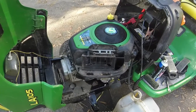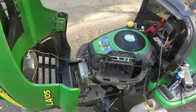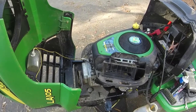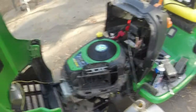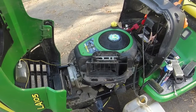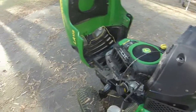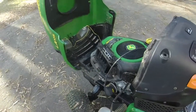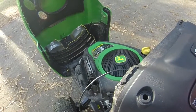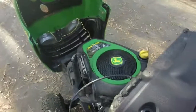I'm gonna clean the plug once again, because I think, like I said, it's fouled, and I will try one more time to get it going. If not, we'll catch this back up in part two, just so part one doesn't get so long. And yeah, so we'll see what we got. All right, I'm getting spark again. A little bit of starter fluid in there. And so let's see if it'll turn over without getting fed this watery fuel.